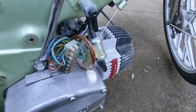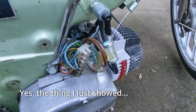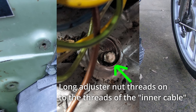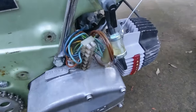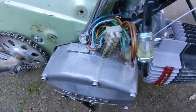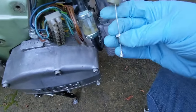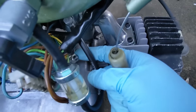Alright, starter clutch cable time. I'm here for my third time because the first time I had the spring that is part of the plastic starter mechanism in the wrong slot, so I tore everything apart and got that corrected. The next time it turned out the long adjuster nut was not actually threaded properly — it was cross-threaded a smidge. Took everything apart, found that out, got it all back together. This mechanism is pretty simple when you've taken it apart a couple of times, but the first time it's kind of intimidating.